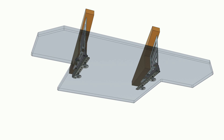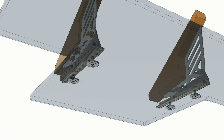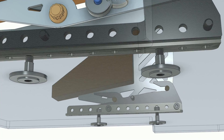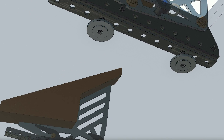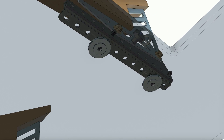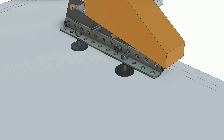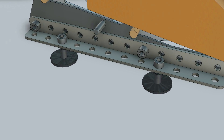Regarding no hardware under the splitter, I've decided to use weld nuts attached to massively oversized washers to distribute the load. We'll pass these through the core of the splitter and bolt to them from the top. Even if we do grind these away on rough roads or on track, we can still get them out — we're not relying on the head of a bolt being usable after sustaining damage. Because they have an open end, we could put a bolt and nut in, tighten the nut, and back them out from the bottom side, making this relatively foolproof. I'm really happy with how I've decided to mount this splitter, so now we just need to get these parts cut.